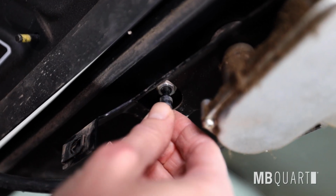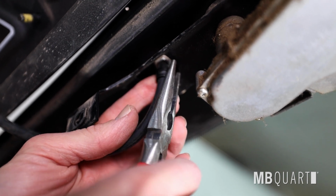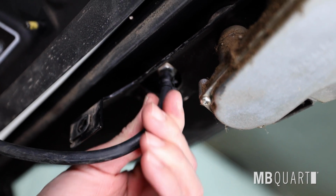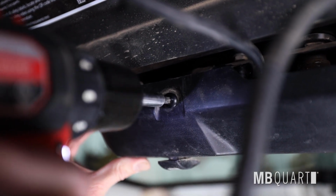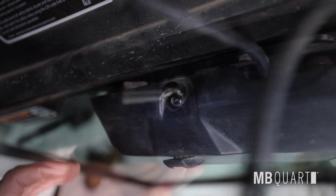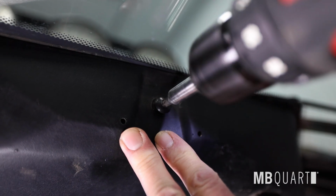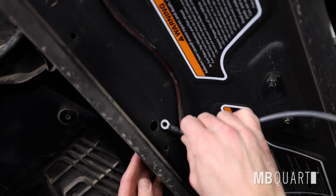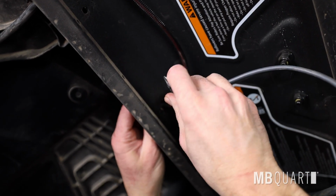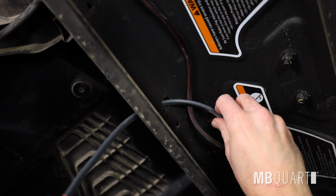Reuse windshield washer hose check valve and hose clamp. Please note, black side of check valve faces the windshield. Reinstall windshield washer motor cover with 3 T30 Torx screws previously removed. On Defender Limited models only, you have to relocate the power harness through roll cage hole like so. Assemble new supplied bus bar as shown here.